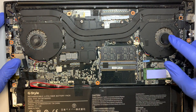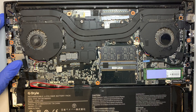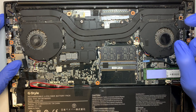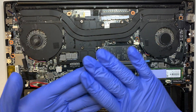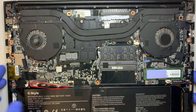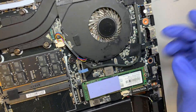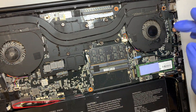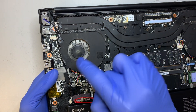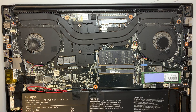Here you get to see the entire computer. The fan here is giving us a slight grinding noise. What happened is that the ball bearings on the fan have rusted, so when it spins the blades are not in an even position and the blade is scraping off the metal — that's the grinding noise. It kind of stops immediately and the spin is not as smooth comparing to the other fan, which goes very smooth.